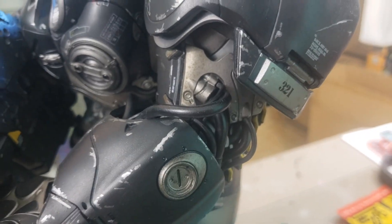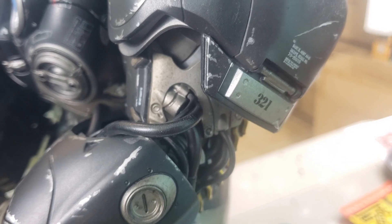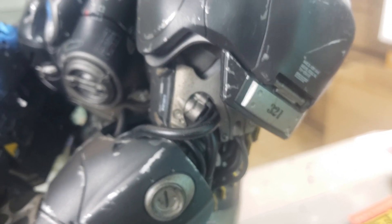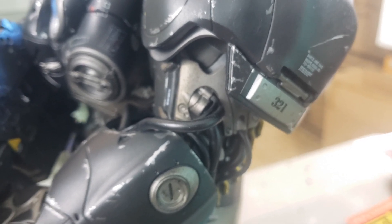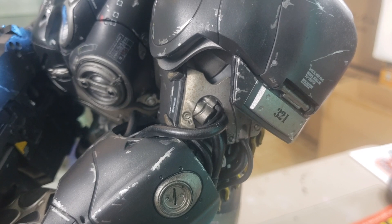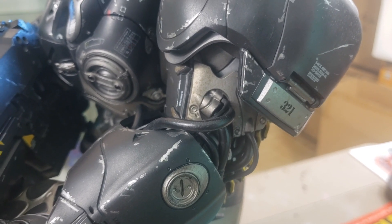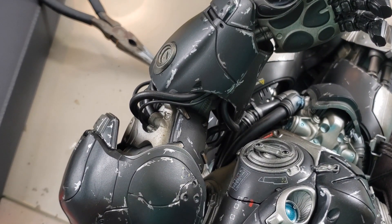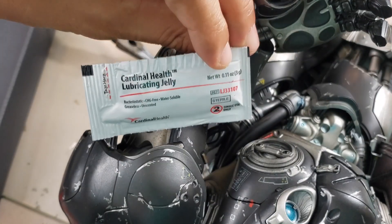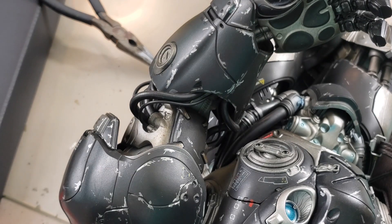Even here, second application — the crack disappeared, it looks like brand new now. This is the tubing that I applied KY jelly on. You take a closer look, you can still see small cracks, but it's not that bad anymore compared to when it was dry. All you need is to lubricate it with KY jelly or any lubricant that is water-based. Never apply petroleum jelly or any lubricant that is not water-based because it will destroy the rubber. So again, only apply a water-based lubricant.